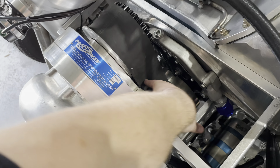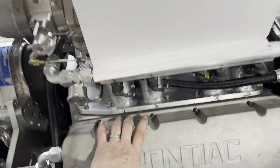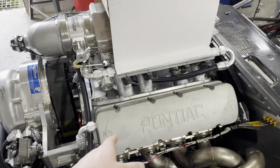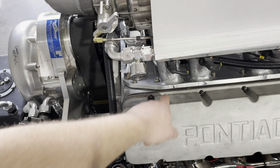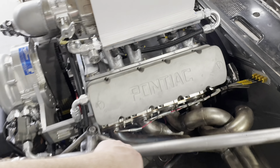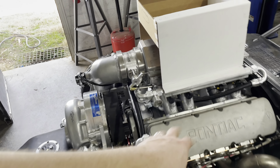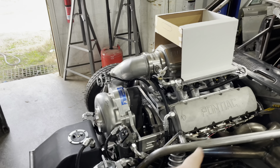The blower belt is a little bit loose — I'd like to tighten it up. These valve covers are big chief Pontiac style, which is what goes on these heads. When I got the motor, it had sheet metal custom valve covers with bulges to clear some of the big rocker arms up top. I didn't hear any valve train problems, but we'll double check it. I need to take it apart and check things anyway, so we'll pull the valve covers back off and make sure all that's fine before it gets run again.